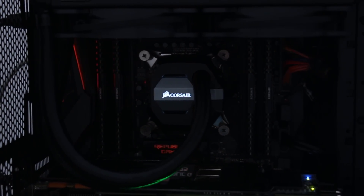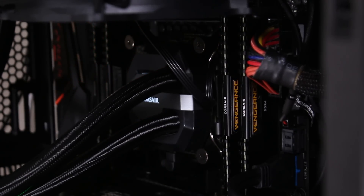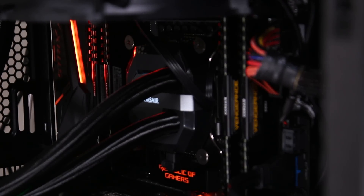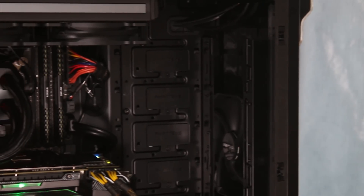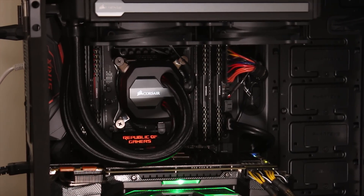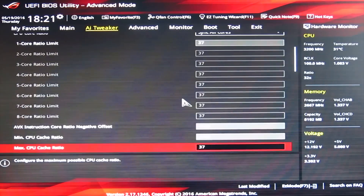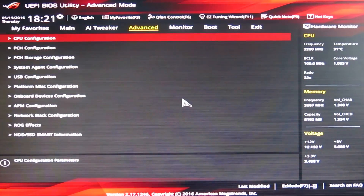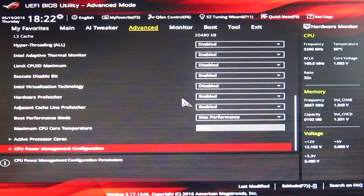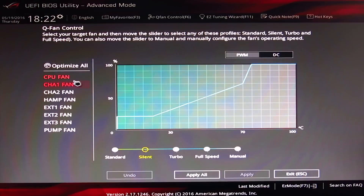Having quad channel support for the memory is really nice. This kit I'm using here is 32GB, but it allows you to do at very least up to 64GB, although technically I believe you can do 128GB, which is pretty awesome. You have plenty of clearance either side, so as long as you're using low profile memory kits you should be perfectly fine mounting any heatsink. In terms of overclocking and the BIOS, it's fairly well laid out and very easy to overclock with — you go into advanced mode with F7, sync all the cores, change the multiplier, leave voltage on auto, and it should work just fine.